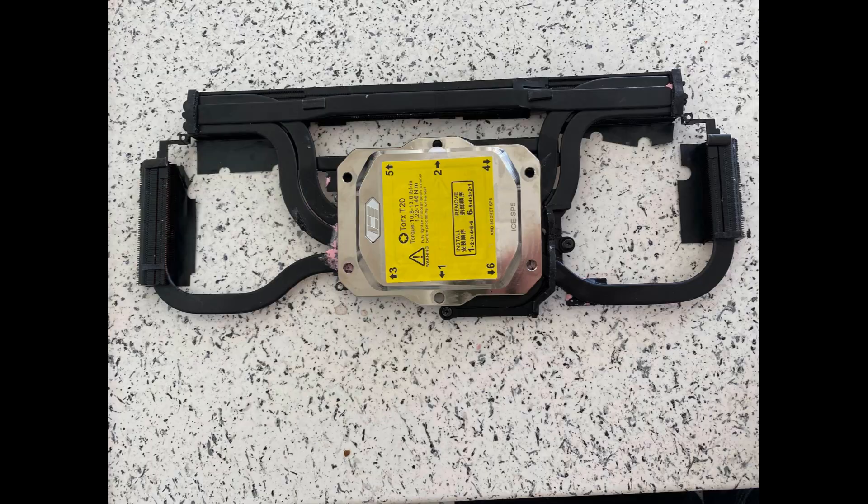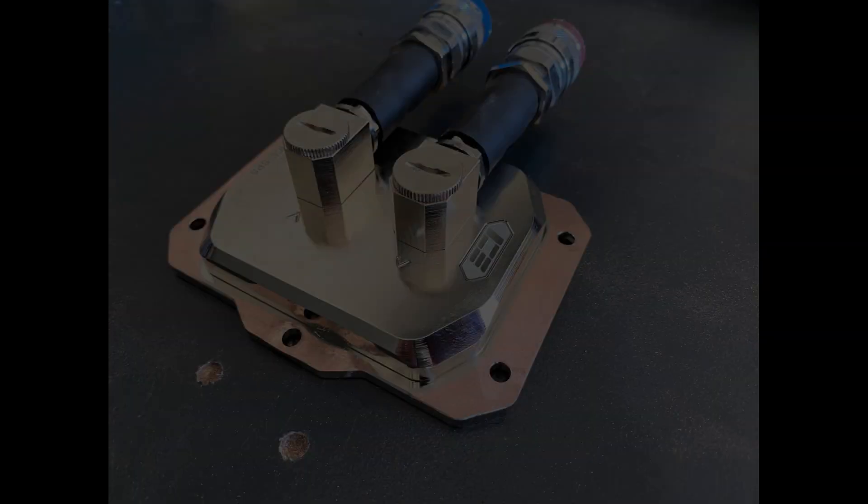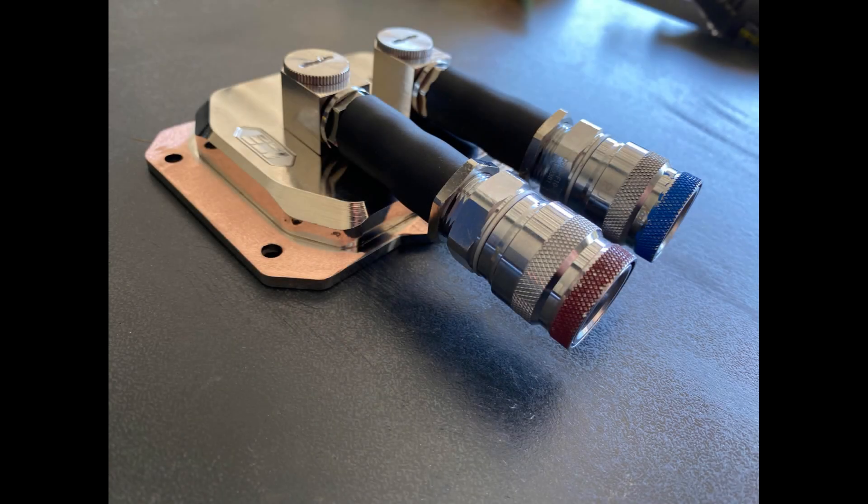Initially I went a little bit too far, had a small pinhole leak, got it plugged up with some solder — now it should be good to go. I plugged it from the inside, not the outside, so that way as the water is going through, the pressure will push the plug into place rather than pushing it out and into the laptop. But at this point, if it leaks it's gonna leak — that's something I accepted months ago, so hoping for the best.